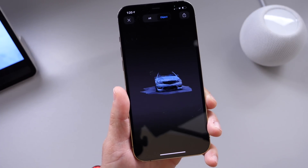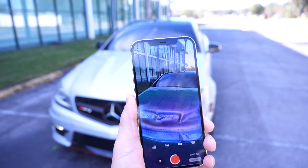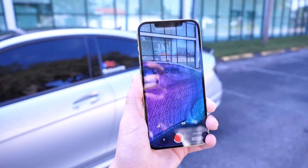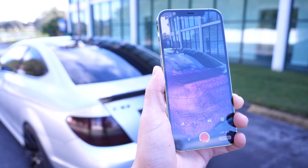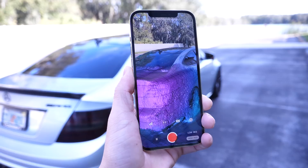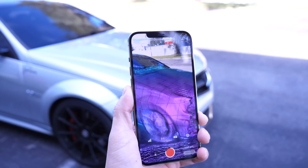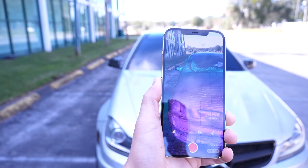To scan the vehicle, I stood about three feet away from it. The closer you get, the better detail you get on your images. One thing I did notice about this technology is that it isn't capable of capturing glass. The front windshield, the rear windshield, and also the roof were not captured by the 3D scan because it just doesn't reflect light. As you can see, the closer you get, a purple highlight appears on the vehicle, meaning it's getting more data points into the sensor and scanning a lot better.